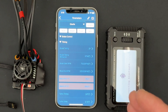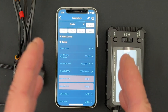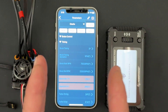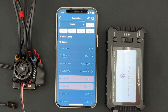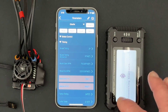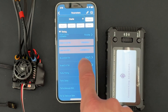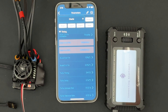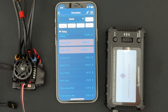The wider the boost RPM range is, the smoother and more gentle it comes on. If you want it all to slap on real quick, you can run a very narrow RPM range. You can also move that RPM range around your throttle band to give you different start and finish points of boost application. The throttle method gives you a start throttle percentage and an end throttle percentage — very simple. For example, if you want boost to come on at quarter throttle, set it to 25; finish by 75% throttle, set it to 75.